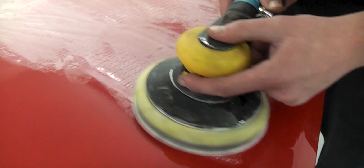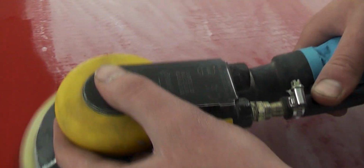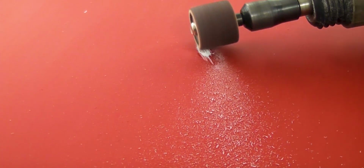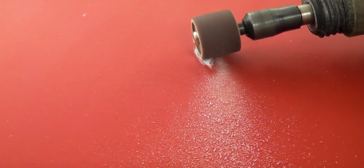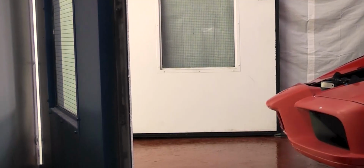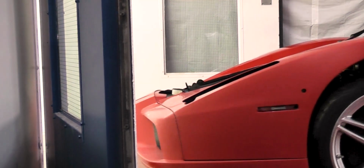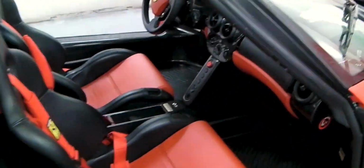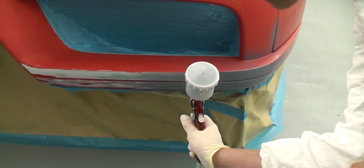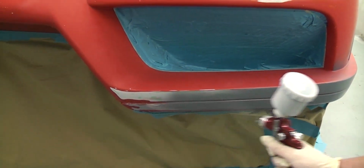So what you're now going to see on camera is a lot of stripping down and rubbing down, and as you can see there, can you see the pattern and weave? And yes, this could be classed as sacrilege, that as you sand and prep and repair cracks such as this and sand down flat the original paint, you technically remove the weave look from this Enzo, which we discussed with the client in a lot of detail. You can imagine how difficult, tricky the conversations are with the pros and cons of creating perfect paint on a car that would normally not have perfect paint. Customer trusted me, so the rest really was just a matter of getting the car done.